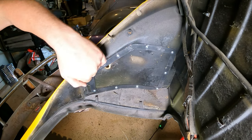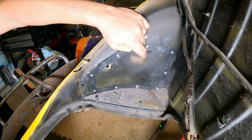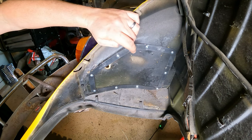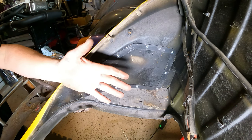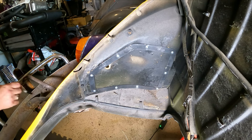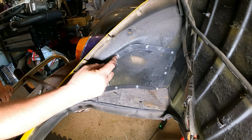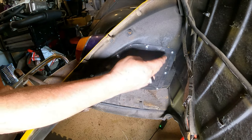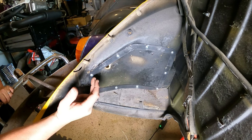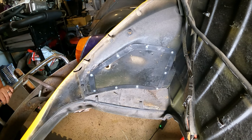So you can see we've got a nice tight fit - it's angled to go with the body right here, it kind of sits right along the bottom. You can see I did have to make some hammer adjustments to get it to contour properly to the body - you want it to be kind of a nice tight fit. And that's where drilling these holes out bigger on the body is going to come in handy, because this is now deformed from the cover and it's going to be a little bit hard to get that thing seated otherwise. So we'll mark it on the outside - this is just to mark the holes - and then we're going to flip this over to the fender side, screw it in again using all the same holes. Then we mark it, then we cut it from the outside, trim it from the inside, and then bring it back in here and tack it up and screw the face on. There we go, so we're all marked. We'll get this thing unscrewed, move to the other side, and move on to the next step.